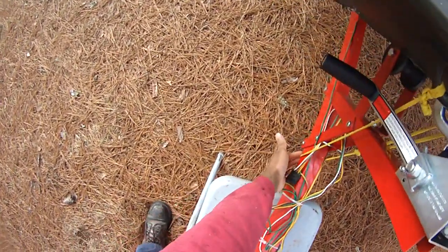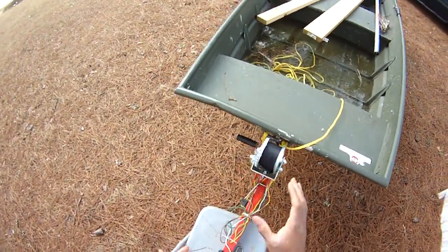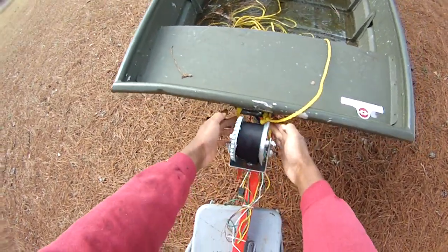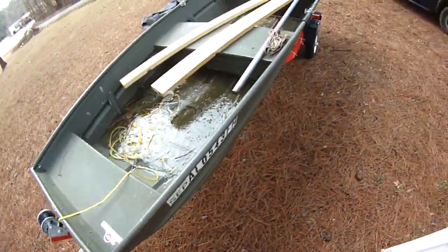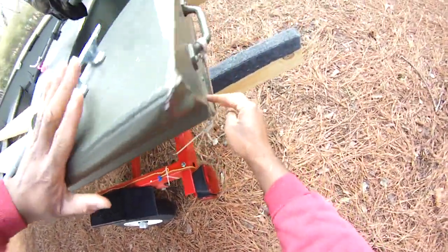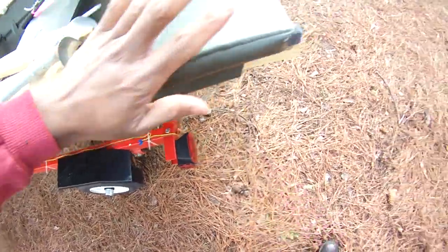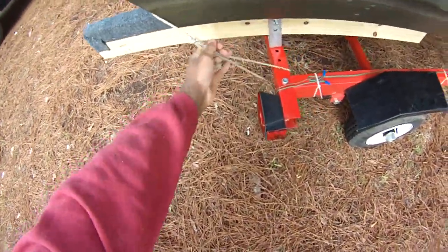Because the bow is angled like this, it'll catch if the boat slips back. I need to re-tighten it. So on the front end: the winch is locked, and then you have an additional trucker's hitch securing the nose down. Then on the back, you have handles here going down to a trucker's hitch straight down, with the same stopper knot and anchor knot — a modified trucker's hitch, but a trucker's hitch nonetheless. Same thing on the other side. That's how it goes — it just won't move. It's secure.